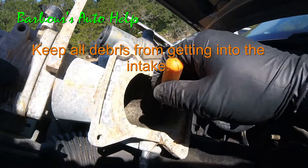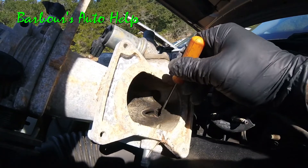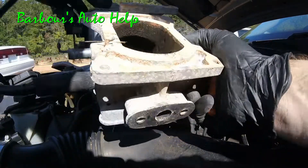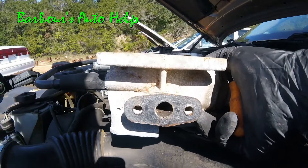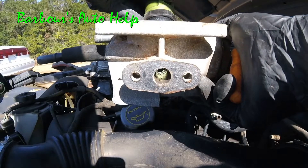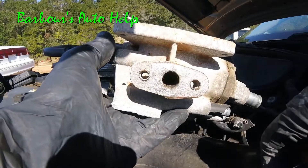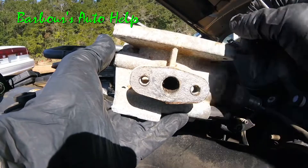You'll need to use your repair manual for the instructions on how to remove and replace this. So we're just going to pick all that stuff out, kind of roto-root it, get it nice and clean, so we've got a clear shot through there. This one's not really that bad, but if it's more than 50% — maybe 80% or so — clogged up, it's going to cause insufficient flow.